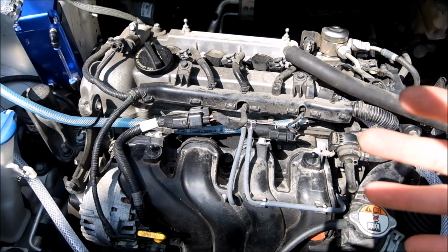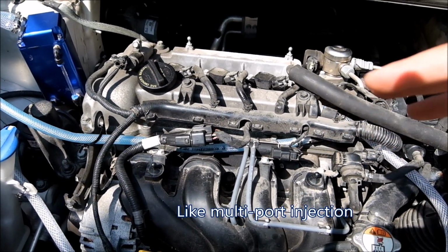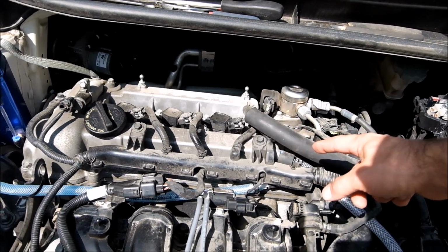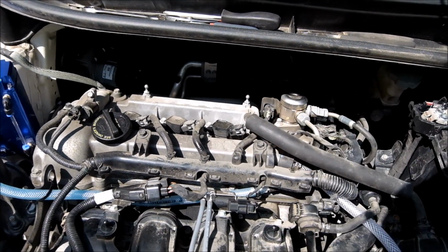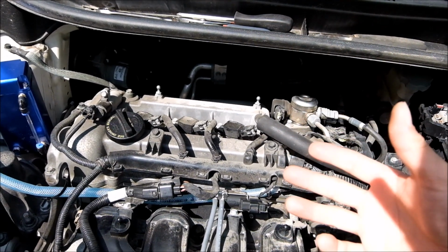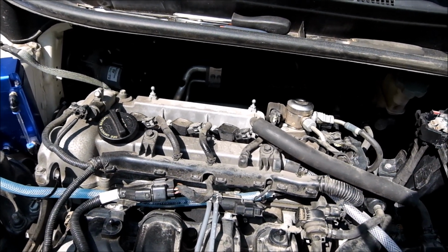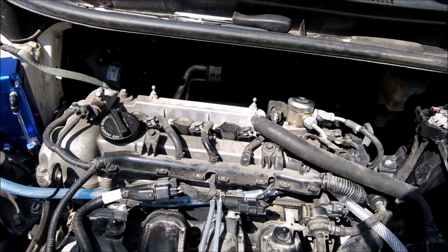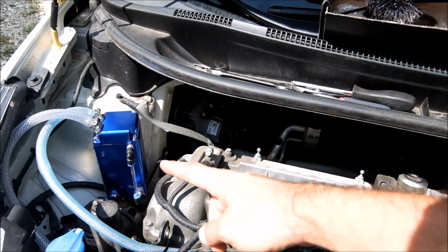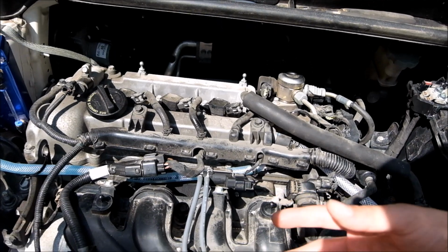These engines, because you don't get the injector wash of the fuel, those valves aren't getting clean, but they still have to take the positive crankcase ventilation, which is going to have a natural mist from the oil circulating. It's hot. There's going to be slight blow-by on the rings. It's just normal, a little bit. Especially if you've got a turbo, you'll have a little bit more. Anyway, by giving a chance to condense those vapors in there, your air returning back to the manifold should be cleaner.